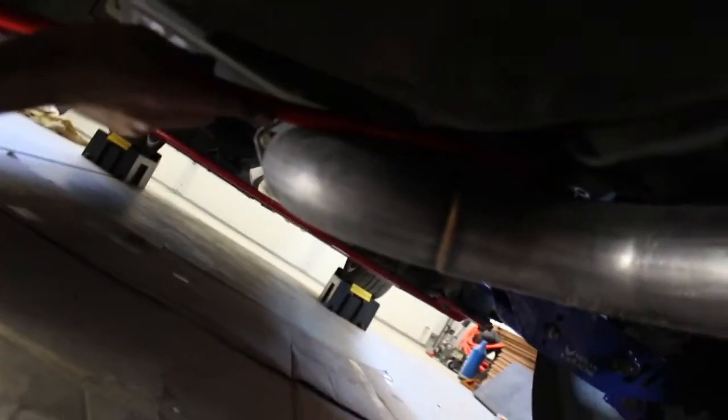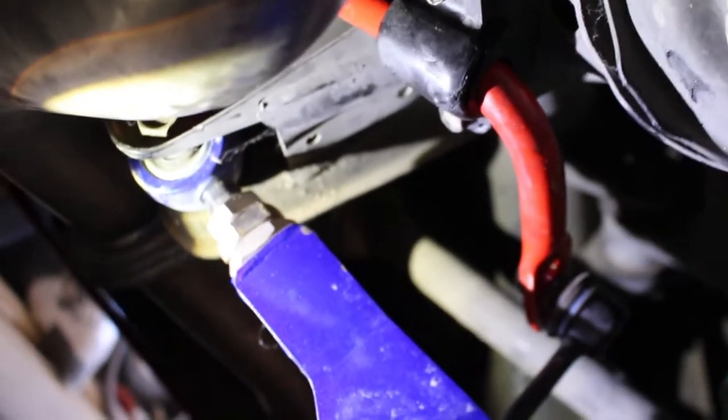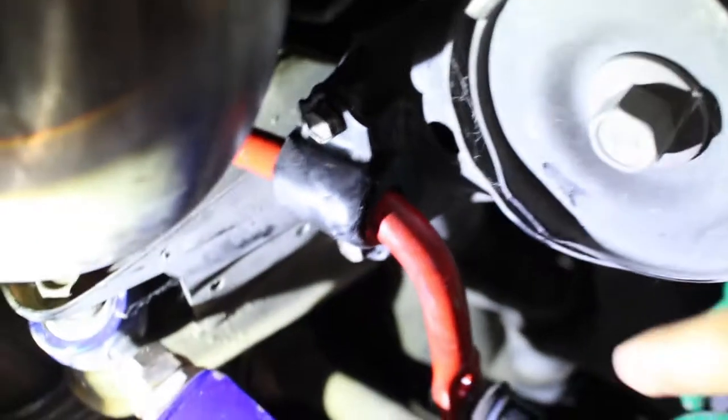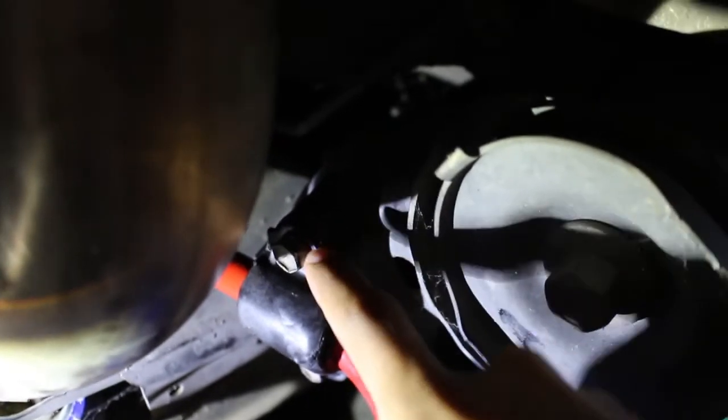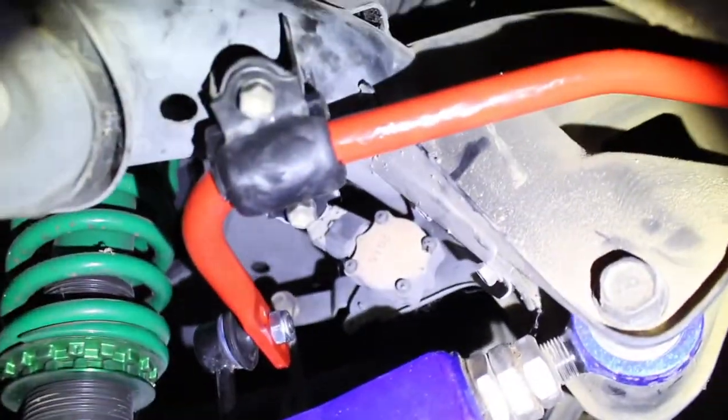If you want to be lazy and not lift your rear exhaust section, you're going to have to finagle the sway bar into place. We found it easier to put one side in first and then work your way to the other side. We pre-mounted the brackets in — screwed them in just a little to have enough clearance to put them on the other side. Now we're tightening everything up.